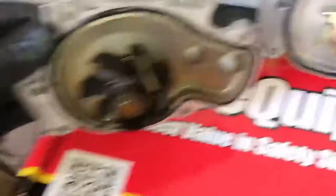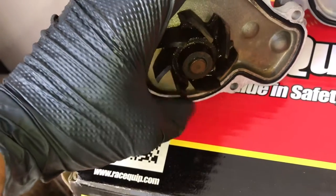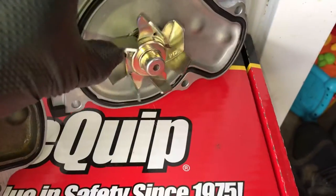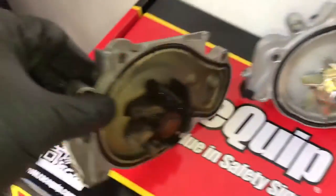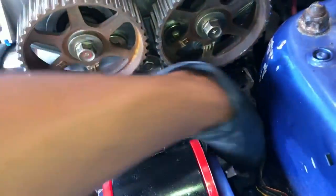Here's the eBay water pump, here's the OEM one. As you guys can see, the fins are still good on the eBay one, but from this side it doesn't really spin that good — it's kind of hard to spin, not seized. You can see it's more of a protrusion into the slot where it goes, whereas the OEM one has more room for water to enter the fins and spin. The OEM one is brand new so it's a little unworn, but it just feels easier to turn already compared to the eBay one. This eBay pump is almost blocking water passages and won't allow any to go through. Hopefully this will be the fix — we're going to get this in here and see if it fixes the coolant flow and lets the motor cool down at idle.